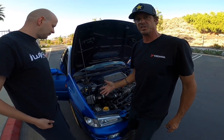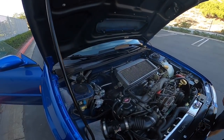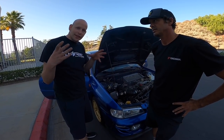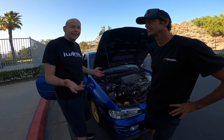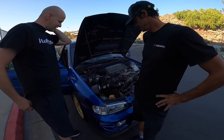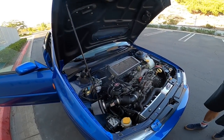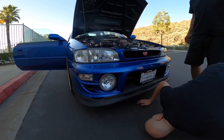Where is all this smoke coming from? Is this like the burn-off from the turbo? So you've got a little bit of oil from the turbo. We did the valve covers as well, and when we pulled those off it did dump oil into the heat shields. So this is going to be common. Now if it burns for an excess of like five days, then go and take a look at it. Also look on the ground and make sure there's no dripping. More than likely this is going to be common - really common on the power steering side too. This all comes apart and gets put back together, so inevitably somewhere on the power steering side things will burn off. Just give it time, it'll be fine. Make sure you look underneath and check for leaks.